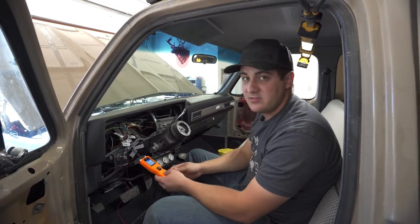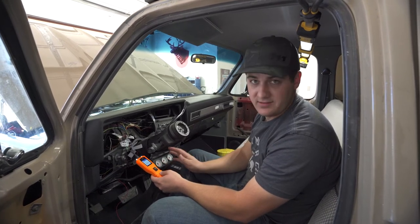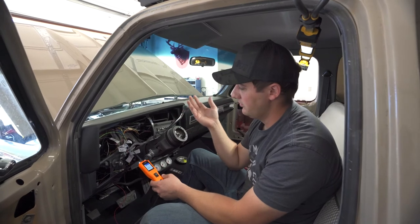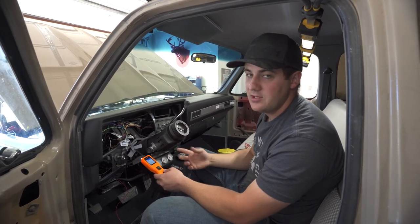Because of the dip switches, the gauge is programmed, so you can just butt connect the fuel sender into your harness on the correct wire and be good to go. However, in order to test it, you need to test for ohms and test your ohm resistance — that's another lesson for another day. Still, look up your factory wiring schematics for your factory gauge cluster and that will tell you what to do. Some other wires you're going to need to look up are things like your turn signals and your brights.